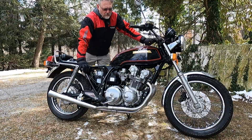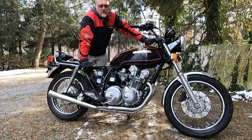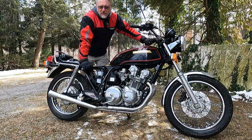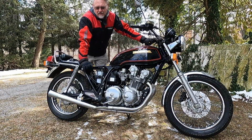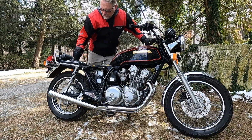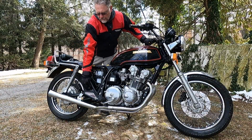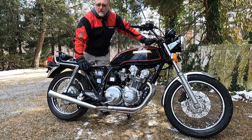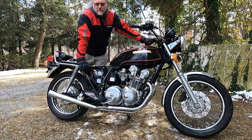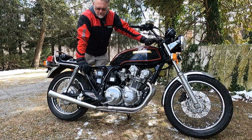Today, I am once again with Honda's 1979 CB750K barn find project. And if I were going to title this episode, I would call it Electrical Gremlins. So in the last episode, you saw what we did. We actually got the bike fired up and started. Man, I'm just looking forward to getting this bike on the road. And I did a kind of a final pre-flight check. I checked my running voltage as the bike was warmed up, and what I realized is the bike was not charging. And so then I knew I had to look at the charging system.